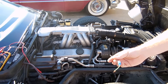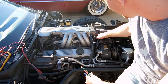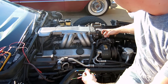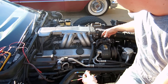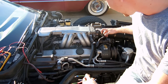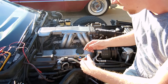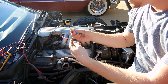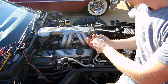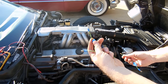Basically what you're doing is checking voltage that goes from one wire to the other. This is your throttle position sensor. What you want to do is take these three leads and jumper this pin with this pin — the middle one with the middle one, the bottom with the bottom one. If you look at this connector, the top part is A, B, and C. C is your ground, and then A and B you want to check voltage in between them. I've made special little jumper wires that fit in both ends — this one goes in C, this one in B, and this one in A.